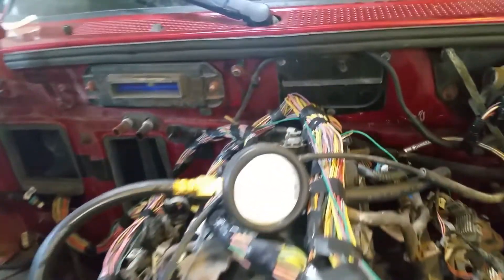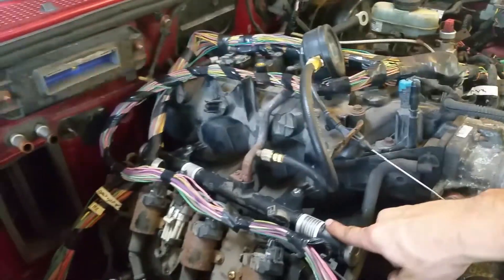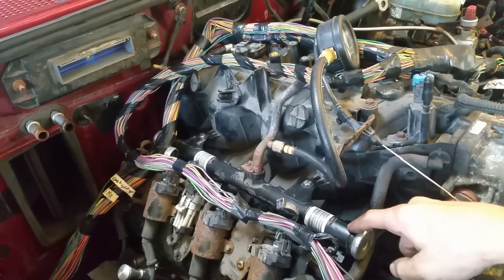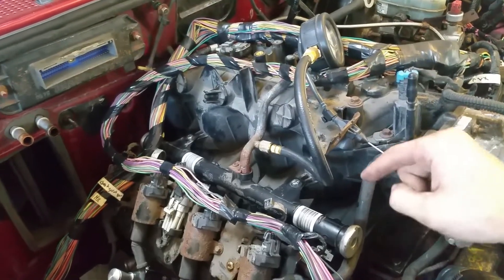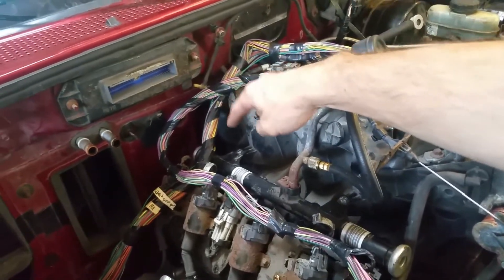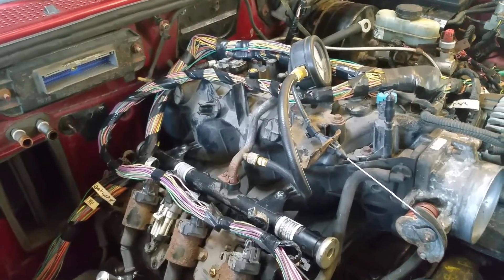I do have another thing I want to look at — this issue right here. So this was fully pressurized, about 60 pounds, probably an hour, hour and a half ago, and now it's at zero PSI. No fuel pressure left — it's not holding pressure at all. I'm going to prime the pump and see which injectors are leaking. This is actually a pretty fast leak, so I'll probably be getting new injectors or something like that. I know the one on the number eight cylinder was leaking pretty slow — overnight it would be down to like 30 PSI — but now it seems like it's almost just stuck open. So maybe they're dirty, maybe they need to be refreshed, but I'll probably just get a new one that doesn't leak.